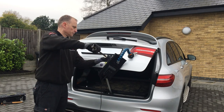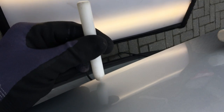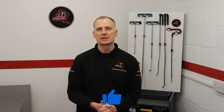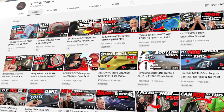Job completed and another satisfied customer. Looking back on this repair, I started using plenty of glue tabs which really helped bring up a lot of the metal very cleanly, which massively reduced the amount of pushing needed with the PDR bars. Probably the hardest part was bringing up the sharp center of the dent without stretching the metal any further, and the other difficult part was removing the hard frame line from the lower edge as you really need to be accurate with your tapping down. It took a bit of work but I was really pleased with the result - having the knowledge, the skills, and plenty of patience really paid off. If you like the video please give it a thumbs up, subscribe if you haven't already, and click the bell icon to be notified when a new video is uploaded. Thanks for watching and I'll see you on the next one.